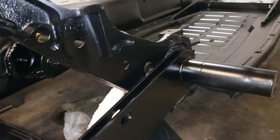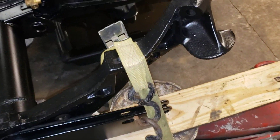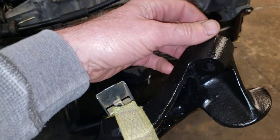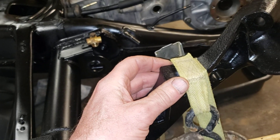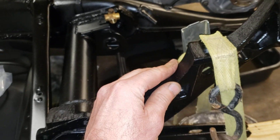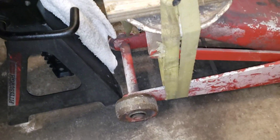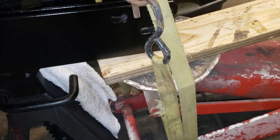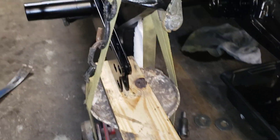It's not good on the torsion spring plates to do that. The way I do it is I take a floor jack and just use a regular motorcycle strap around the top of the shock tower — your shock would normally mount here, but this is one of the body bolts. If the body's on the car you'll have a little trouble getting looped up here, but loop the strap around here somewhere. Basically you're strapping your floor jack to the car, then put a block of wood under the spring plates.